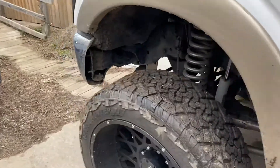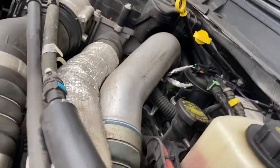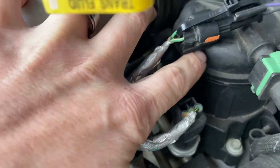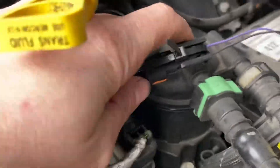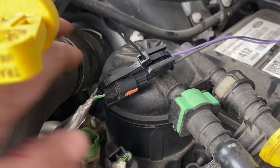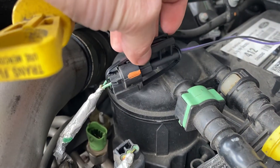It's a big truck — six-inch lift on some 37s. On the 2011 to 2016 models, you plug it right here: take out your factory plug from the green harness right by your fuel filter. Run this through the firewall — purple goes to green, and black goes to white and green. Make sure those are plugged in right; mine liked to wiggle loose so I just zip-tied mine together. Thanks everybody, hope that helps.